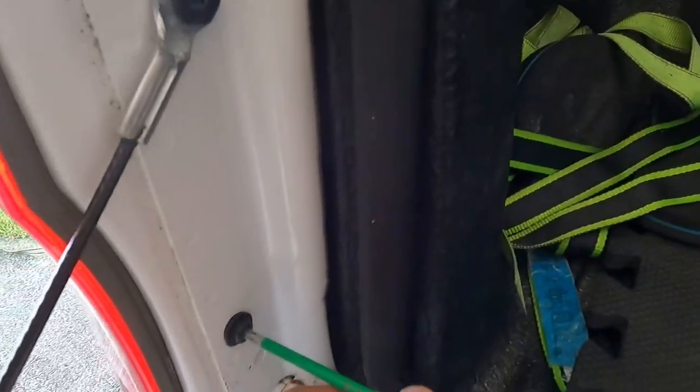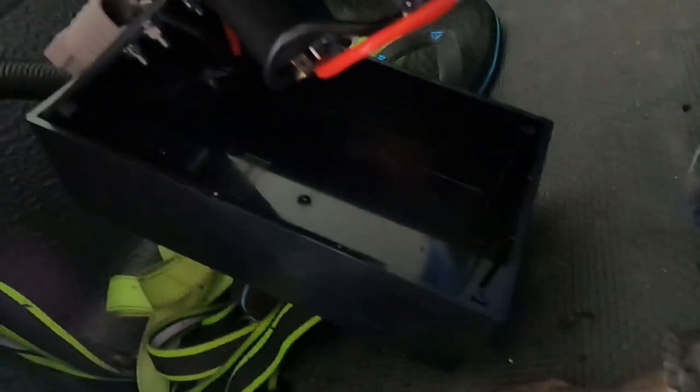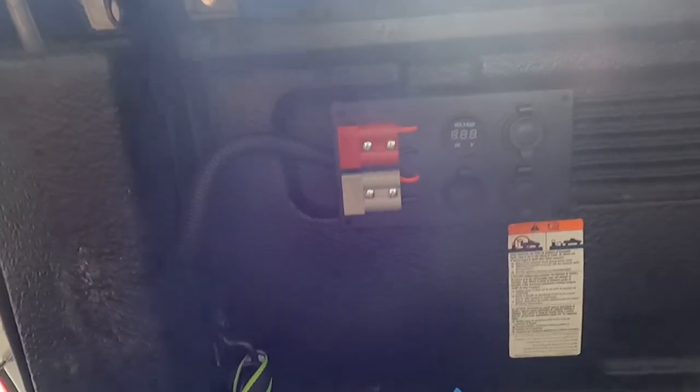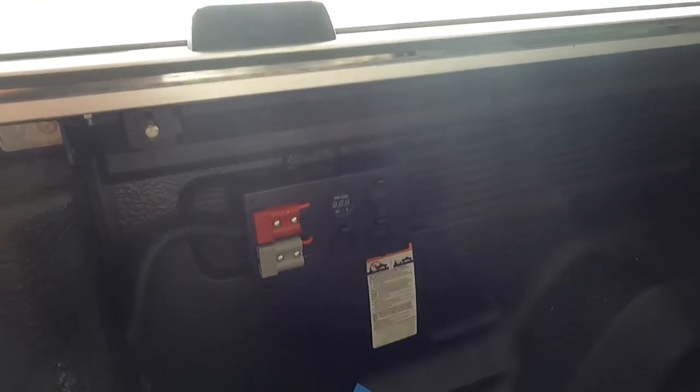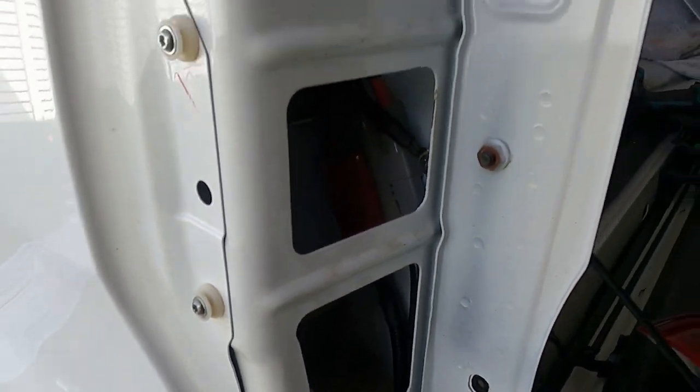It says to pull this light out — just a couple of screws here, undo these and pull it out. You don't actually get any mounts to screw for this. All I've done is take the front plate off and screw through it onto there. I've thrown a bit of silicone on it too, just for good measure. There it is — all mounted. One of those screws happened to fit perfectly for my earth, so I've just earthed it like that. The tail light's back in and so far it's working.